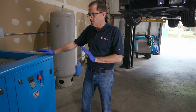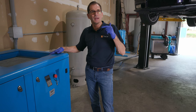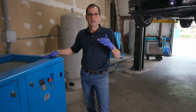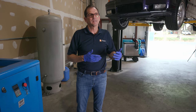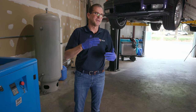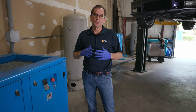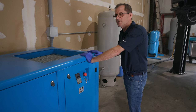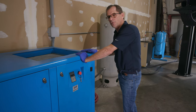The bottom line is you cannot do this work at the highest level without a 40 horse compressor. Don't kid yourself that a 25 or 30 will get you by. And if you're selling a dry ice machine, you're a salesperson, is it in your best interest to convince someone that they need a big compressor or a little compressor? Well, the reality is you've got to have 40 horsepower, and here's why. So this is our compressor. Let's presume I did the right thing and didn't learn the hard way. Let's say this is a 40 horse compressor.